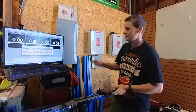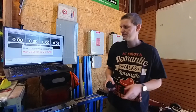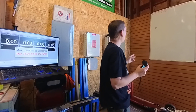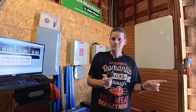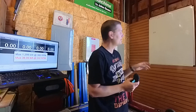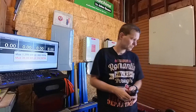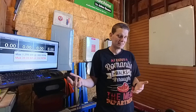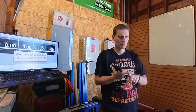The torque was pretty impressive: 36 foot-pounds, and it ramped up really quickly. As a comparison, the electric bike I tested yesterday had a max of 1.29 kilowatts — the skateboard had a hair more power than the bike. The bike had basically 33 foot-pounds of torque and the skateboard has 36 foot-pounds. So for something that weighs around 30 pounds versus an electric bike in the mid-60-pound range, that's pretty impressive. The watts are basically the same as the bike, the torque is more, and obviously the weight is a lot less — so with a skilled rider on the road, the skateboard will be faster.